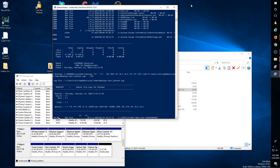Hey guys, while I was copying the 1TB to 5TB, it got me thinking about something I should mention: this is the Xbox One X provided by JP that you're going to see in this video, and I skipped the step of showing you the system working before I made the copy to the 5TB drive. I can't stress enough that if you want to go to a 5TB system, you have to have a working drive. You can't just go directly to a non-standard drive. You have to have a working 500GB, 1TB, or 2TB drive.